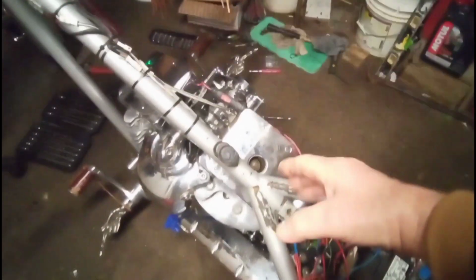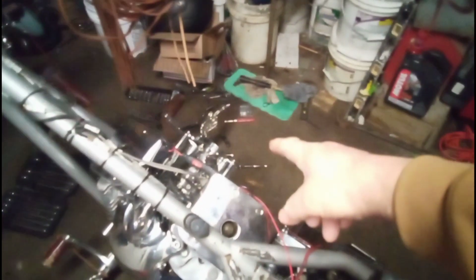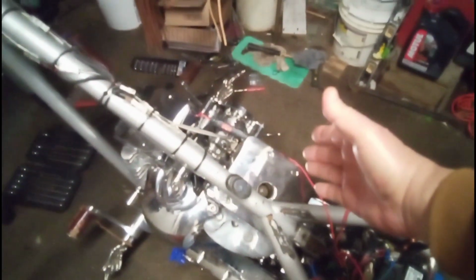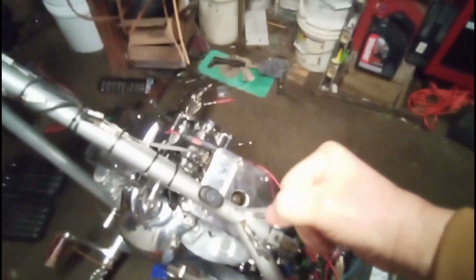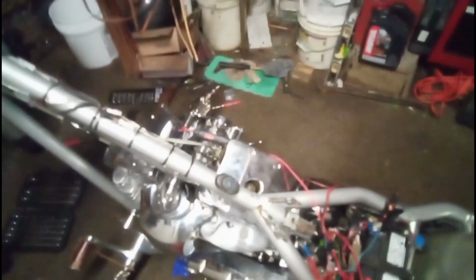I don't know if you guys have ever seen them, it's like a metal bar. You'd have to get one that's made for sockets, that way I could use my hex or Allen key sockets. Then you turn it, and you hit the top of the impact driver with a little hammer, and it turns. It'll get those out. I've gotten the most stubborn fasteners out with that manual impact driver.